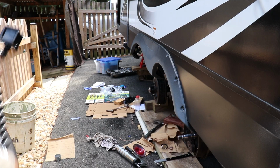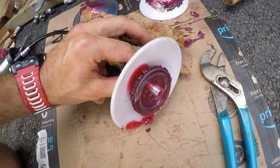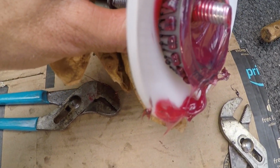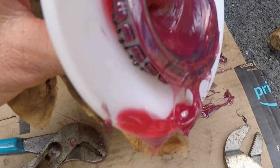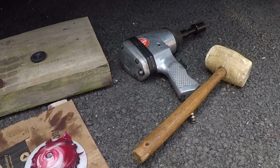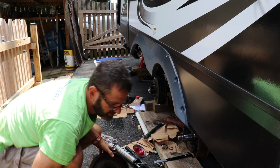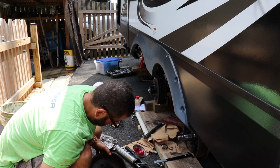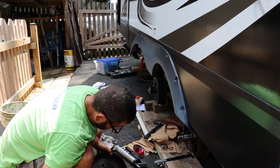So there we go. So the new bearing packer worked so well that I'm pretty happy about it. So the idea is that you push the grease, push all the old grease out, goes through the slots, which I think I have here. I'm super happy about that. Got the drum, and what I'll do is put the bearing back in and reseal it.